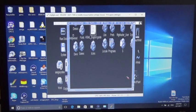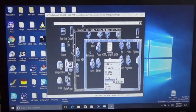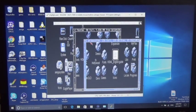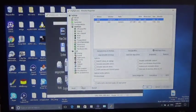So what you do is, this is my CF on the Windows hard drive. I would right click, Draw window, select contents. I keep my finger on shift and drag them all into the blank drawer on the SanDisk CF I've just plugged in. And that is it. Once it's copied it all over, it'll take 10 minutes or so, there or thereabouts. I need to press function on this because F12 is Wi-Fi disconnect. So we'll quit that.